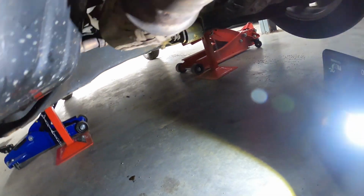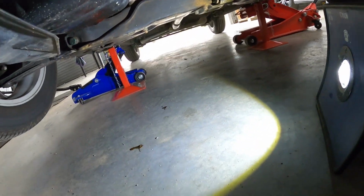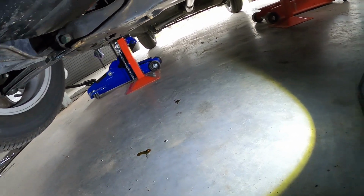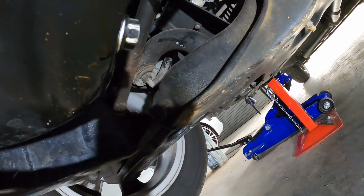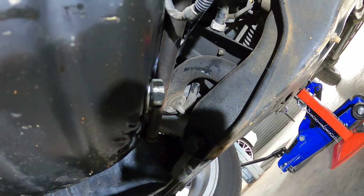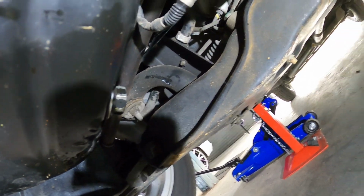Now, this is why servicing your car is so important. Have a look at the little bit of oil there. I reckon our sump plug, which is just over here, has actually got a washer that's leaking. Or in fact, the washer may not even be operable, so time to fix it.